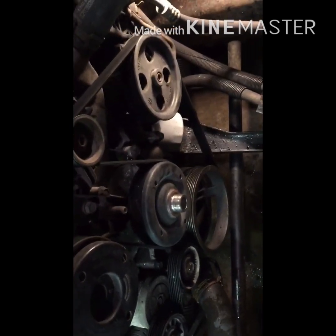And before you take the belt off, either take a mental picture of how the belt is routed, or draw a little picture or something, so you know how to put it on later and you're not struggling. Okay, I always start by pulling that pulley off because it gives you something nice to hold it with. You don't have to, but trust me, it's a whole lot easier.